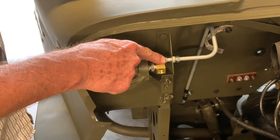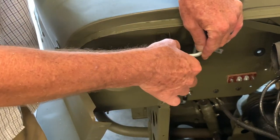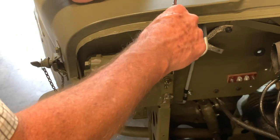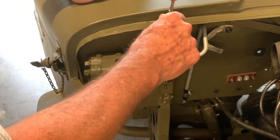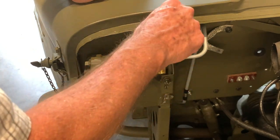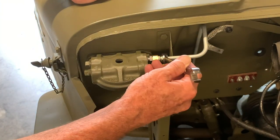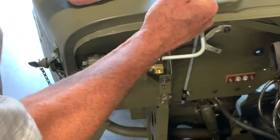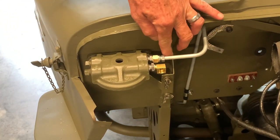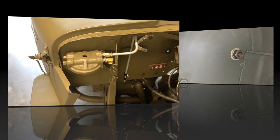I'll demonstrate how the flare wrench works around the fuel lines. Notice the little flared end on the fuel line — you want to make sure that goes perfectly square to your fitting before you install the nut. If it's not perfectly square, make your adjustments now. Don't force it in using the nut, or you'll cross-thread it or damage the fittings you already installed. Make sure it's nice and square so everything spins in easily. Spin the first part in by hand, then use the flare wrench over the top of the fuel line itself to tighten it down.